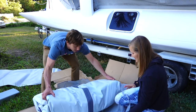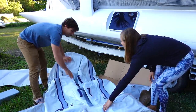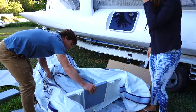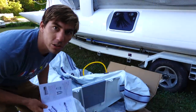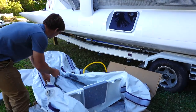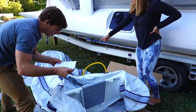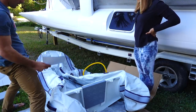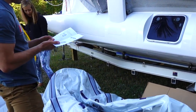So there's the boat. It's so cute! It's a hard aluminum transom. This looks very similar to our CL 360 - heavy duty - and a little plug in the bottom there. So we read the owner's manual. We have to first put the inflatable floor in here, then inflate the floor and tuck it up underneath the sides. You inflate the floor before the keel because the hole in the floor goes over the keel. Then we inflate the floor some more, then the keel, then the tube.